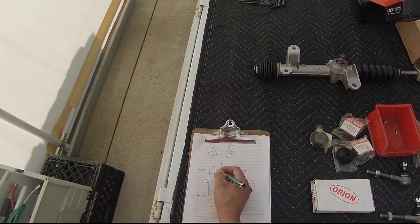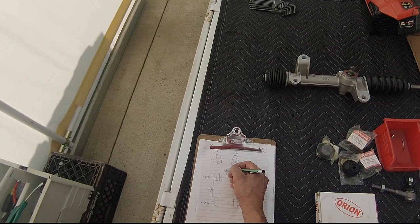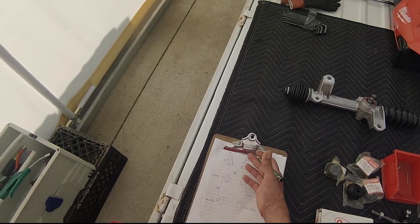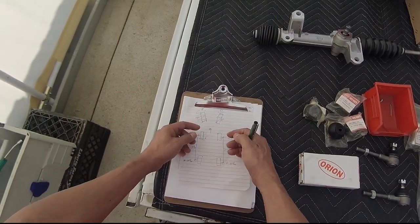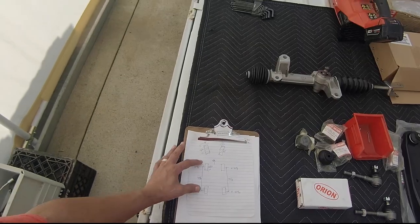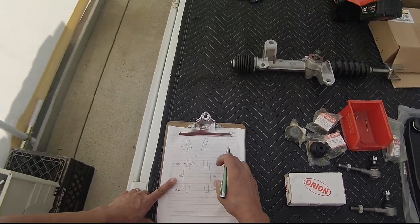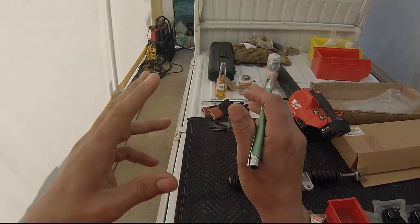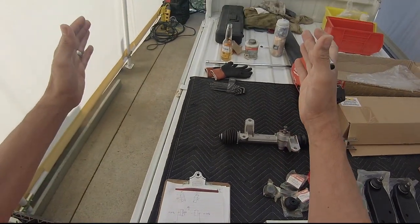It could be that the A-arm, that control arm, and you have a bushing on the inside and one on the front and one on the back here. It could be that these bushings are worn or loose, or maybe this one's worn or loose, that this A-arm is actually going like this, giving you the smaller, or this A-arm is going like this, giving you a larger dimension here. That's why it's hitting, and that could be one of the many reasons for the death wobble, because the front tires are not sitting parallel to the back.